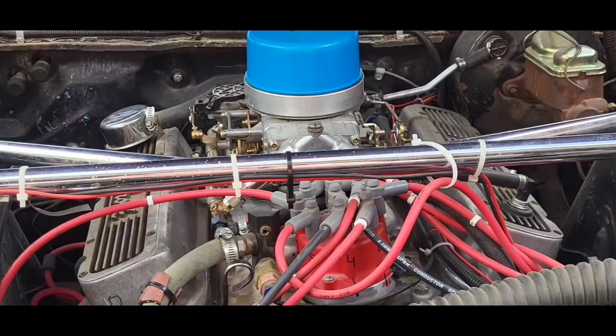I guess that was the wrong way. But before, when I had it, I'd set the lifters at zero lash and I'd rotate the push rods till they stopped. And then when I came back to it, some of them had bled off. I figured, got to be hydraulic. Well, damn, I wish these people knew. It has cost, you can't believe how much in problems and time.